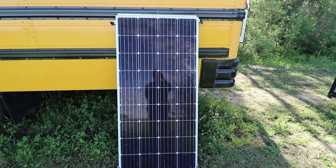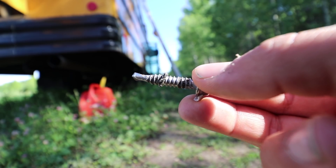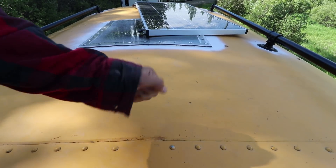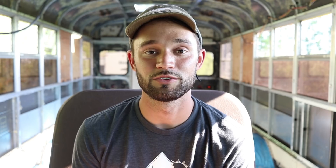The reason why you want to use these structure points is because in between them you're going to be dealing with just 16-gauge sheet metal. And the sheet metal honestly is not really worth much when you're going down the road at highway speeds and have to deal with wind speeds and lift on your panels. A lot of times when people lose panels it's because they simply use screws and are just relying on the flanges of the screws to hold back all the forces from wind and lift, and the screws will rip through the sheet metal. So if you can, find the strongest parts closer to your rib structure.